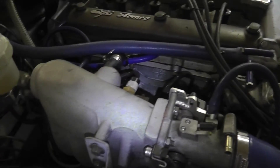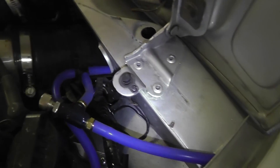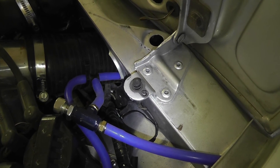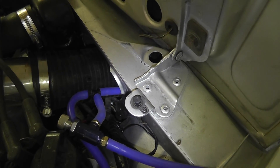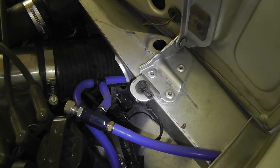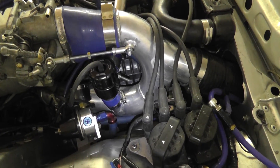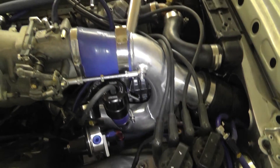I do run the supercharger from the computer as well, but the computer only sees intake pressure. In order to run the supercharger off of the same condition as what the bypass valve sees, it needs to see the pressure the bypass valve sees — not the intake pressure. I only have one pressure input on my computer, hence the manual approach. It's still very tunable and it still allows you to run additional logic on the computer to turn the supercharger on and off based on temperatures or RPMs, etc.